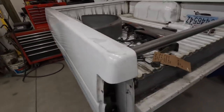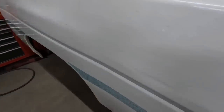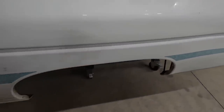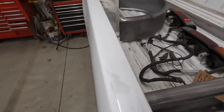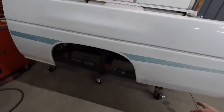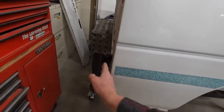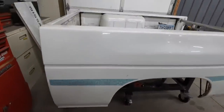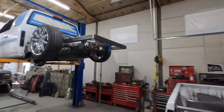There's been a bunch of people commenting 'just pull the bedsides out,' but that's really not as easy as it seems. I was able to pull these bedsides out about a quarter inch, but if you go beyond that you end up with a problem where this front edge pulls back and creates a really bad gap at the cab. Believe me, I wanted to just push these bedsides out and have it look cool, but step one is actually getting some measurements.